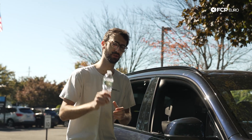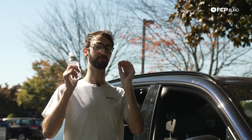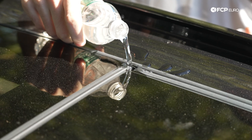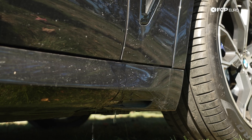I've got a bottle of water here to show you how they work. It might seem counterintuitive to pour this in your car, but this is just a fraction of what happens when it's pouring rain outside. Now down on the cowl, those tubes will drain behind the wheels. Up here on the sunroof, there's a tray — it's called the sunroof tray — and that will lead to tubes which run down the A-pillar and out into the door jam or something like that.